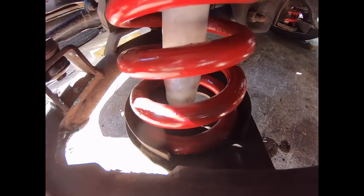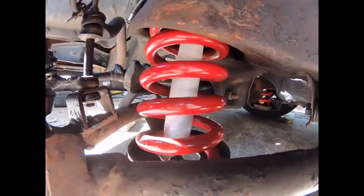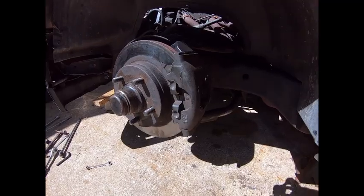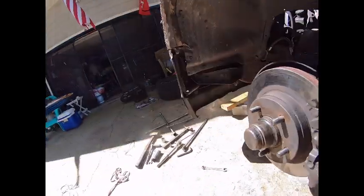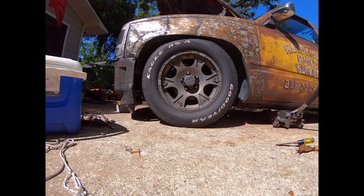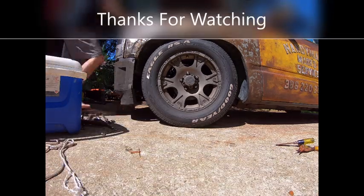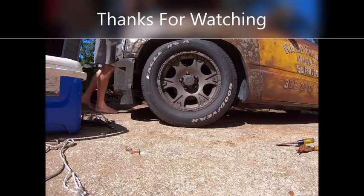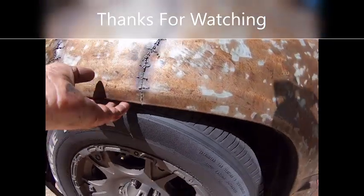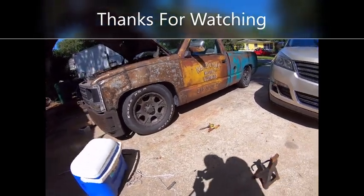That's it, spring's in. If you can see, in the very front of the lower control arm there's a notch — that's where the beginning of the spring needs to sit. It looks pretty good. Nice red spring, got a fairly new white shock in there. There you go — drop spindle installed, cotter pins are all on, everything's been greased. I rolled the fender to tuck that edge in. Darn low, as low as I care to go for now.